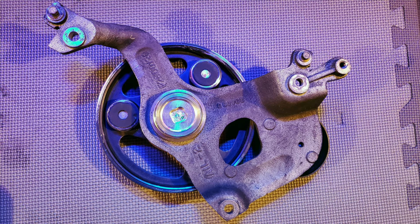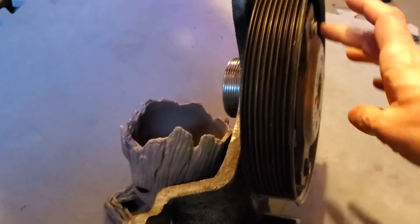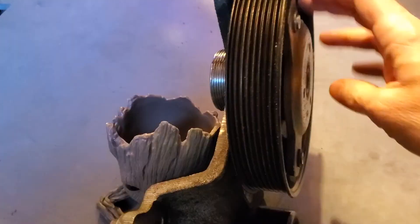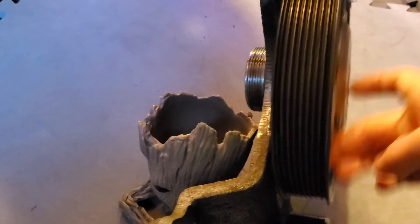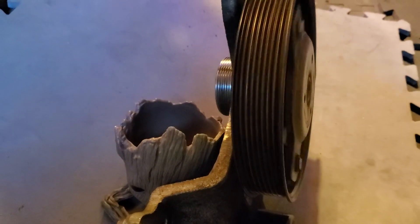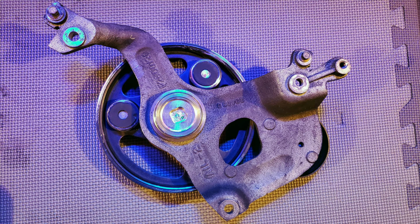Here's the completed product. You can see it sticks out a little bit — I may have to trim a little more — but it's looking really good. This is just a short clip of me spinning it, with Baby Groot holding it up. As I spin it you can see the pulley makes no noise besides the typical normal bearing noise, and there's no wobble, both on the pulley and where it connects to the harmonic balancer. The material is actually harder than the original rubber bushings, and after it's pressed in you really can't budge it — it's a very tight fit.